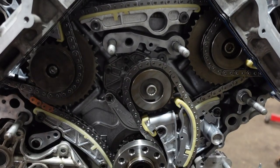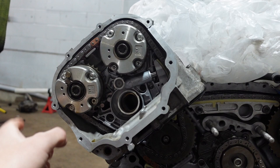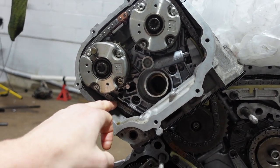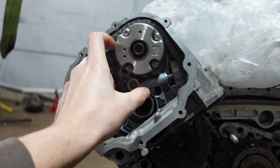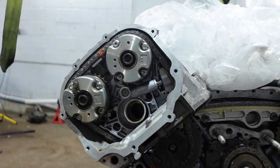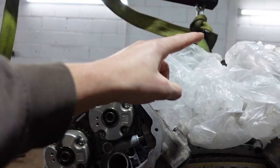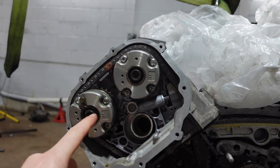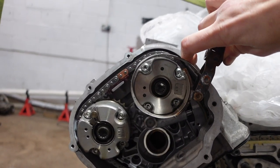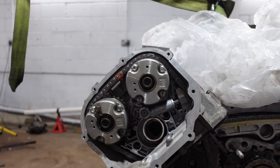All the chain tensioners are now done. These bolts aren't tight yet because we have to put some torque on the inlets to take all the pre-tension out of the chain - any slack on this side of the circuit. There is a special tool you need to fit here to put 40 Newton metres of torque on to really tension the chain before doing these bolts up. I don't have that tool; however, I've found an oil filter wrench which perfectly fits over there, so I can apply the required pressure - I know what 40 Newton metres feels like.